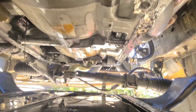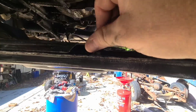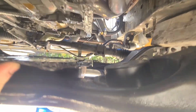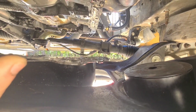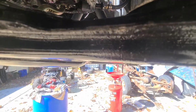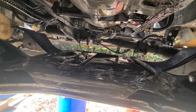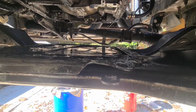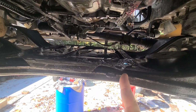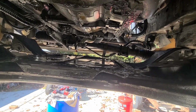The oil pan is off. And you can see this sucker was glued on. I mean, this RTV is thick. So I kind of distorted the oil pan a little bit trying to get it off. You can kind of see I had to pry a little bit to get under it. I'm not too happy about that. Without it being perfectly flat, it may not seal good. And we may just be doing this again in 2 weeks. So I'm gonna weigh my options if I want to try to straighten this, if I want to just try to order one. I've heard there's a gusset kit that you put on the original and it strengthens the rim or whatever. So I don't know. I'm gonna look into some options there.